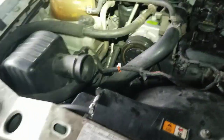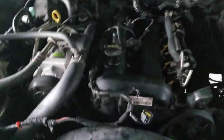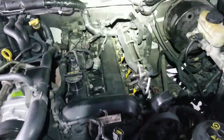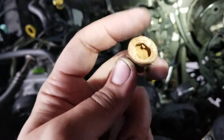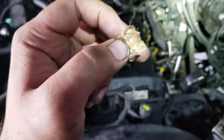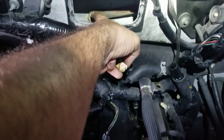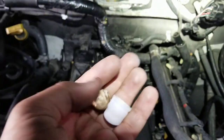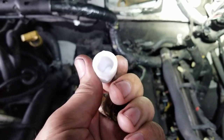What I did was grab a curved needle nose pliers and just worked it until it popped out. This is what it looks like. Normally the ball and socket stay intact but it falls right out of the hole in the arm right here — so we're going to replace it.